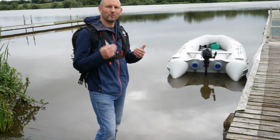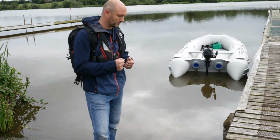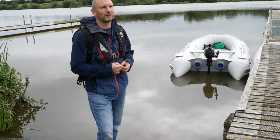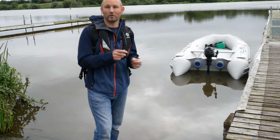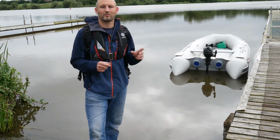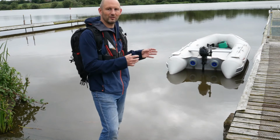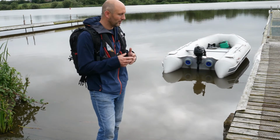The idea being that the petrol coming through the idle jet that has now been cleaned will just, well, help keep it clean. If there is any debris in there, it'll flush it out. Now, this is important, and I've just remembered. If you are going to take your carb off, very easy. I'm sure you've seen another video of mine showing you how to do it.